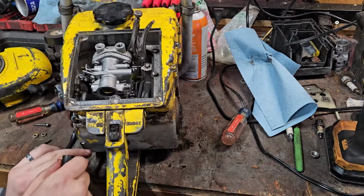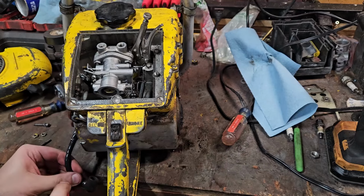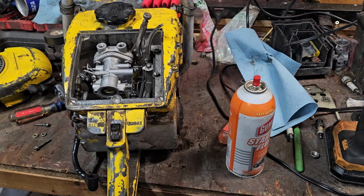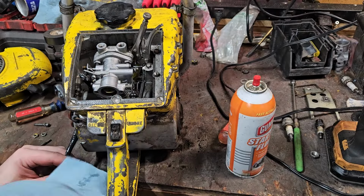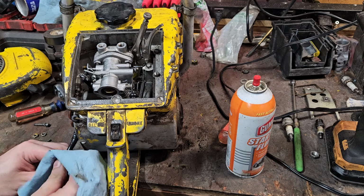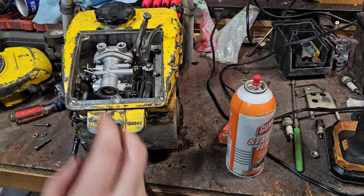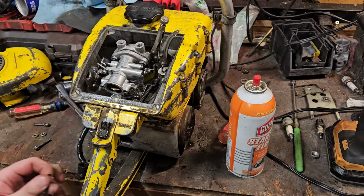Still getting a little bit of something. It's going through, I think, just the entirety of the rubber. Like, it's not having life at all right now. If you were to actually spark that, it would probably ignite. Yeah, I think in the plug head or something, it's jumping spark. That's what the problem is. When it's cutting out, it's trying to get ignition and it's not happening, is what our problem is here.